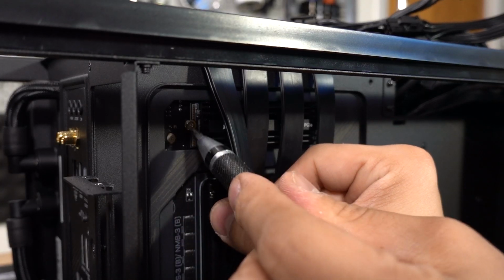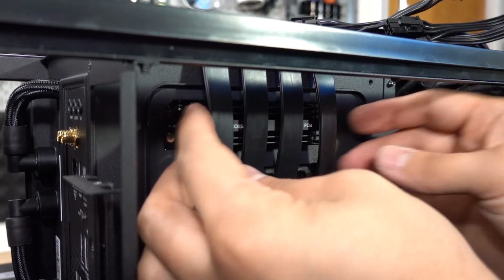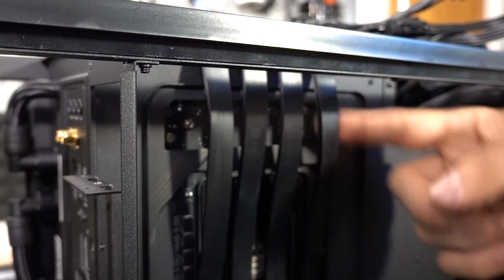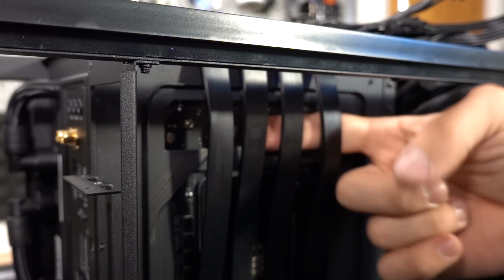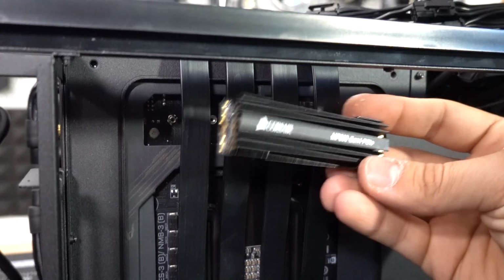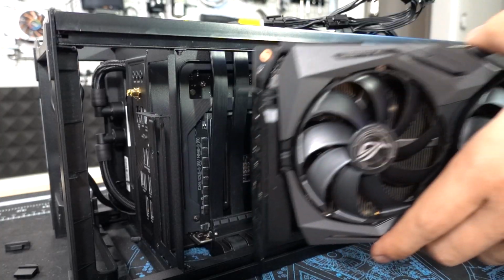All right, well, there you go. I'm doing stupid things so you don't have to. Now you know not to mount an M.2 heatsink drive on the back of this board. Come on, Bubba. Let's go. Now, I would say you could still probably get away with putting an M.2 drive here as long as it wasn't super fast or known to get really hot. Like a SATA-based M.2 drive would be perfect back here, because even though they're not nearly as fast as NVMe, they stay a lot cooler and don't run as high a risk of thermal throttling without a heatsink or active cooling. Okay, BitBoi's going back in.